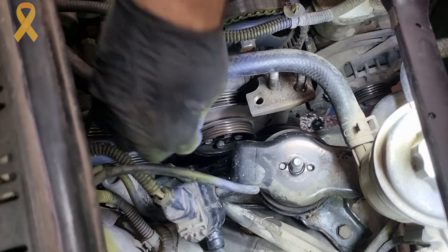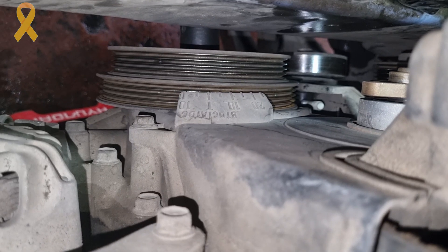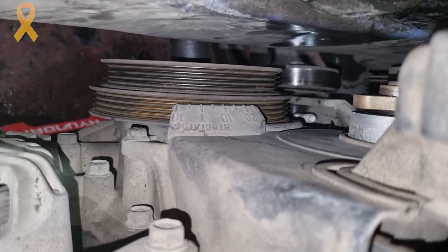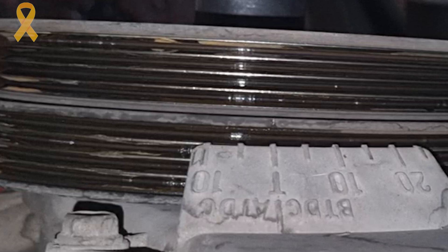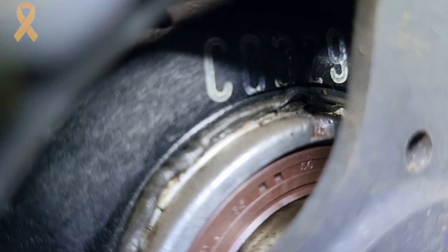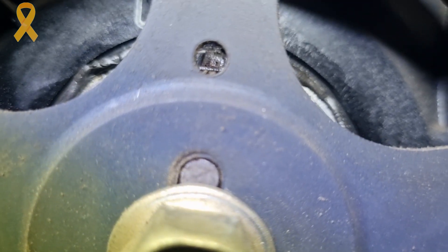We will continue to disassemble the water pump completely by removing the four bolts that we loosened earlier. Note that the water pump contains two pulleys. Using a 22mm socket on the crankshaft, we will turn the engine clockwise to the timing marks. Pay attention to the mark on the pulley that should be in front of the letter T. Make sure the marking on the camshaft is also in place, so that in front of the upper hole in the camshaft pulley there is the marking. It is a bit hard to see, so you can use a small screwdriver that goes inside a hole and make sure it touches the hole behind the pulley.